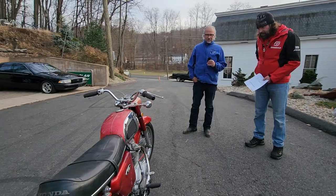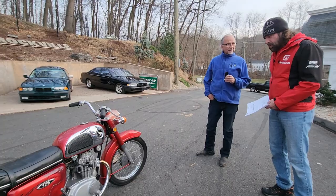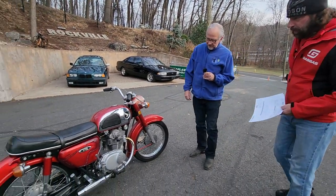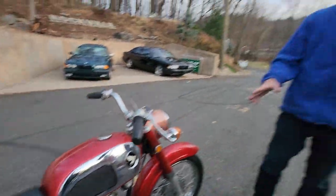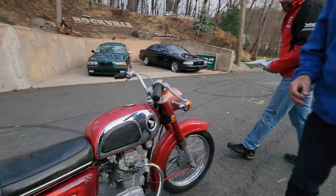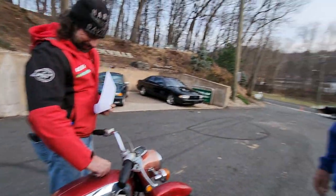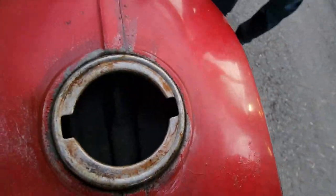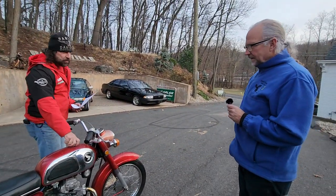And this bike is a good runner. I would like to own this myself. I'll bet you it gets close to 100 miles to the gallon. Yeah, it's got a pretty decent sized tank too — you could cruise all day long. Looks like the fuel cock was replaced too, along with the fuel line. One good thing about these bikes — it's a twin cylinder with a single carb and they stay in tune longer and they're easier to tune. It's just one carburetor service for both cylinders — nothing to synchronize, just get on and go.